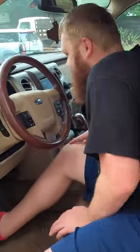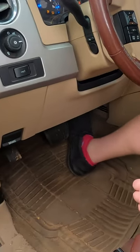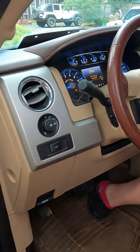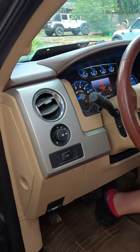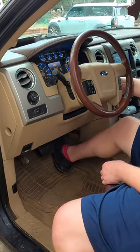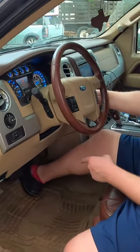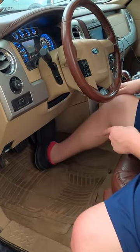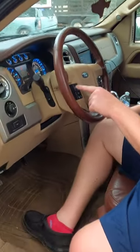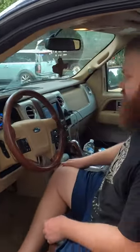If you watch, when he starts his truck, he's going to hold the throttle to the floor and then turn the key and let it crank for a while — and it will not start in this position. So check that out. What you're doing here is that VVT, when it goes out, lets your oil pressure bleed off instead of holding it. So what he basically just did was crank the engine over, manually prime it. And then when you let your foot off the throttle, it fires right up, no clicks.